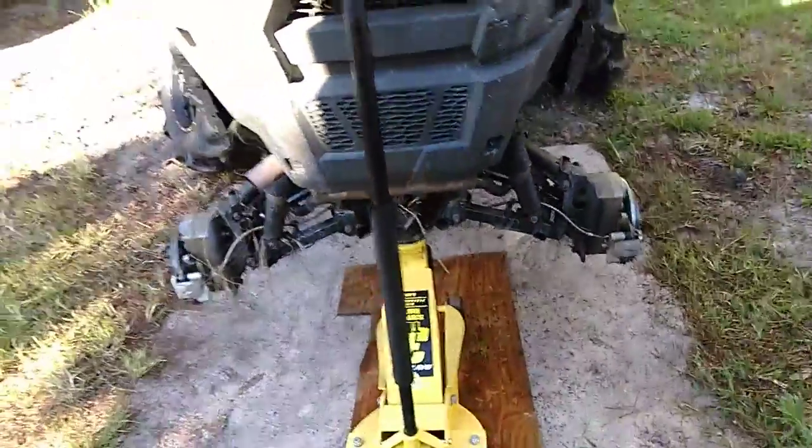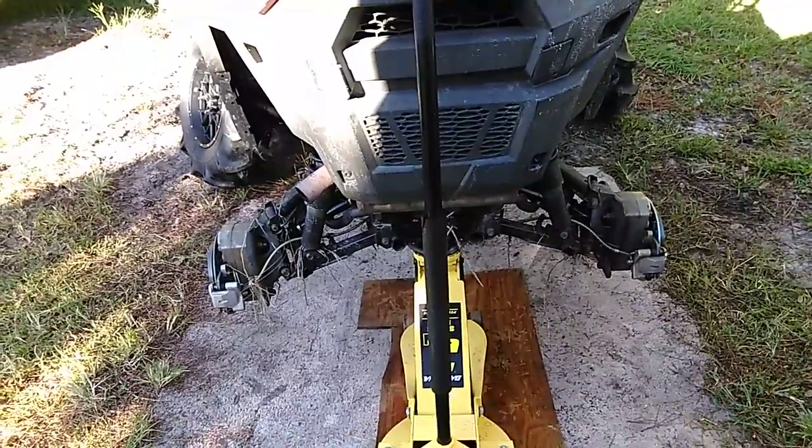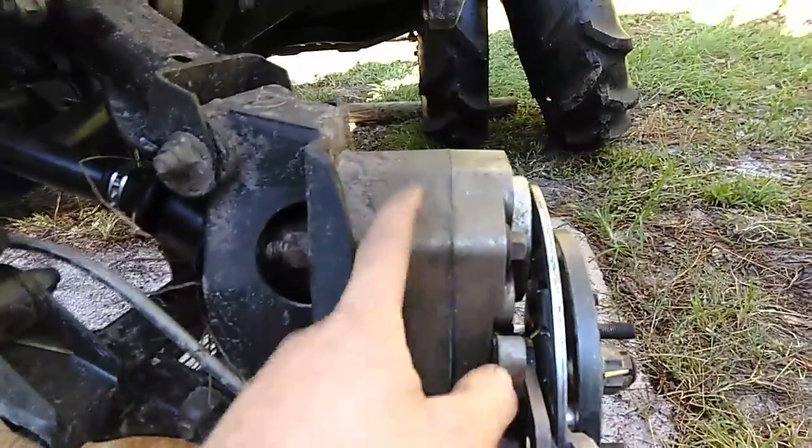Literally everyone I know with portals has issues with them cutting gaskets. Like, it's a major issue, and they didn't even bother addressing it with their Gen 2, because from what I can tell, the Gen 2 uses this same back half, and that's where the issue is. This is where the case is too thin.